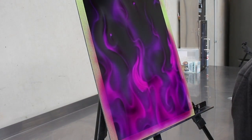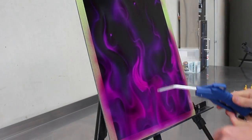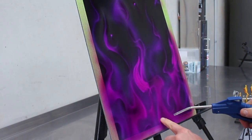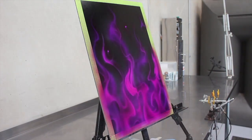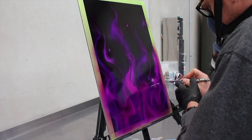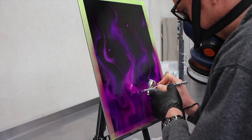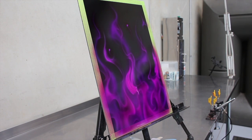Again, with the tack rag, the blue tack rag there, I'm wiping off any of that dry spray that's created from the airbrush. To try and avoid that too, you can add a bit more thinners into your paint. That will help to keep it a bit wetter, but then you just got to be careful not to run it. You can see there I've done a coat using the aerosol pack again with the SG100 Intercoat Clear by House of Colour, and now I'm switching to a thinned down white, so a base coat white in my CMC Plus Micron, and I'm going to now pick out the brighter areas on those feathers and just get a bit more body to them.